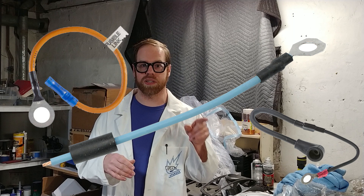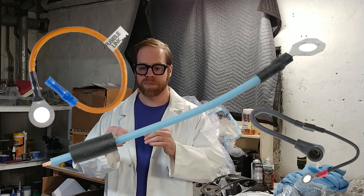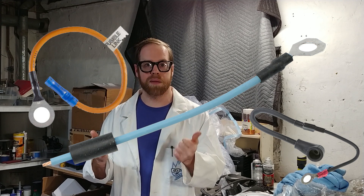Man, you ain't need no fuses at all. Besides that, those car manufacturers, they ain't putting no fuses on the alternator or the starter anyway. Actually, this is quite false. The Society of Auto Engineers had set federal standards for ground vehicle electrical systems using fuses or fusible links in between any power source and their load. Historically, auto manufacturers have chosen to use fusible links in between the battery, alternator, and starter. These go unnoticed amongst most do-it-yourselfers because they don't know what they look like — a fusible link really is a smaller piece of wire in a cable designed to burn up above a certain current draw. Most modern vehicles are now choosing to move over to regular types of fuses in the actual fuse box under the hood.